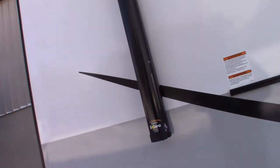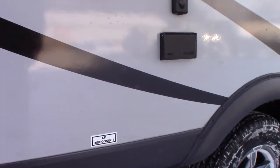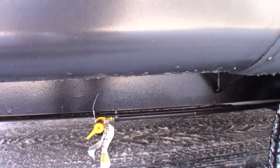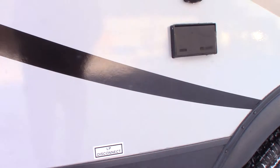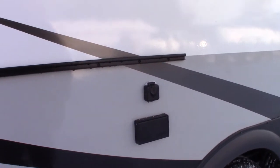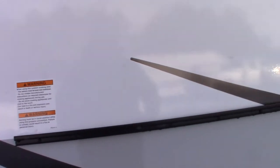While we're out here, you have regular scissor-type stabilizers — it takes a three-quarter crank or socket. This is an LP quick disconnect. The reason it's there is because you have a griddle that hangs right on here, and you plug that in. It comes with a rubber LP hose, and then there's another little utility table that sits next to it.